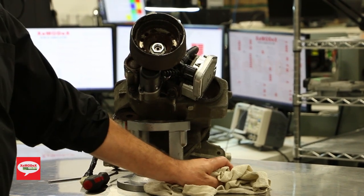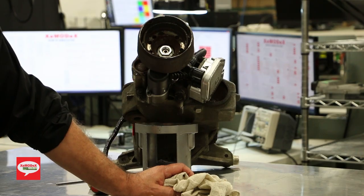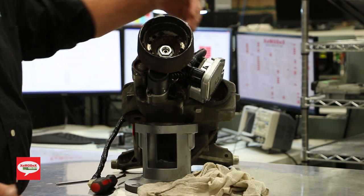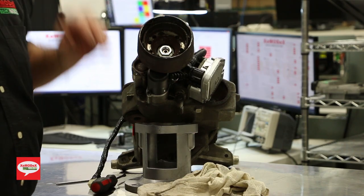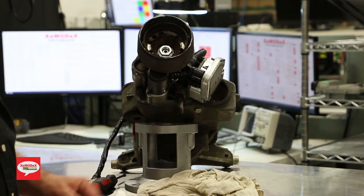Hope this was informative. I forgot to mention that it's a good idea when you have the sensors out, including the solenoid valve or choke valve, that you inspect the seals on them and make sure they're not damaged, because that's the only thing preventing the fluid from coming from the Haldex unit inside the module. And you don't want to get oil in there, because oil can be a conductor, if you know what I mean. It can wipe it out.